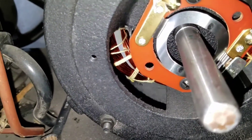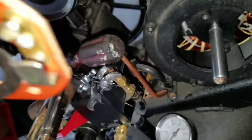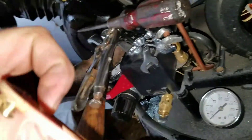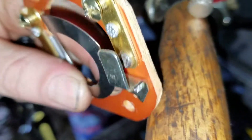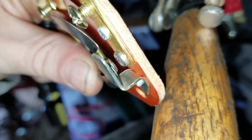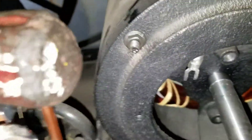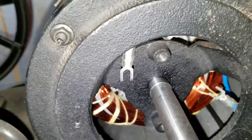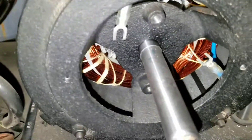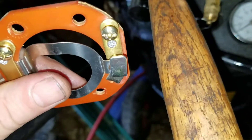I'm going to take this part off — there are two black screws — and then I'm going to clean up the contact points. Here it is, and what we're going to clean are these little contact points right here. As you can see, they're a little bit corroded. It goes back and forth like a two-speed transmission, controlling how the motor spins. I'm going to blow this all out and use some 200 grit sandpaper to clean it up.